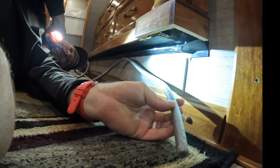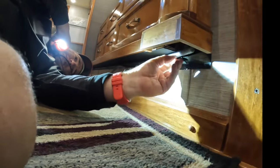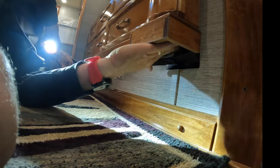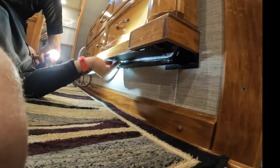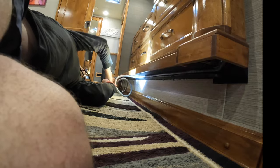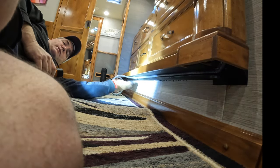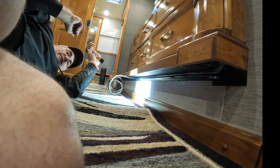We are under the rear side of this slide on our curb side. I'm going to take this backing rod and put it right in this little lip here — very much like how we did the other insulation, I'm going to tuck this guy right here and then work it all the way down. It's going to go right up against the bulb seal. The flashlight isn't great but it's just not very well lit. Basically I want this in here — it's just another layer of insulation. I'll run this guy all the way down, cut it, and we'll see where we're at with the final product.